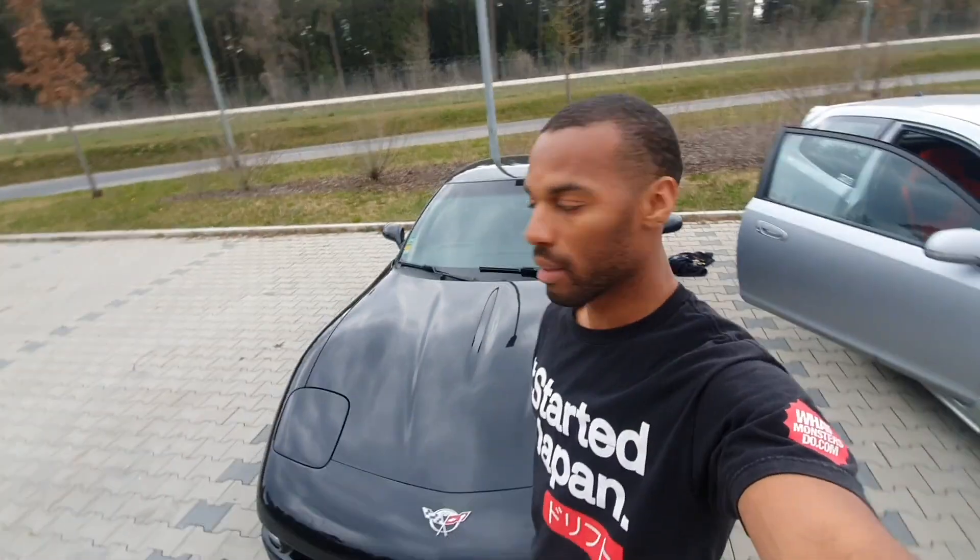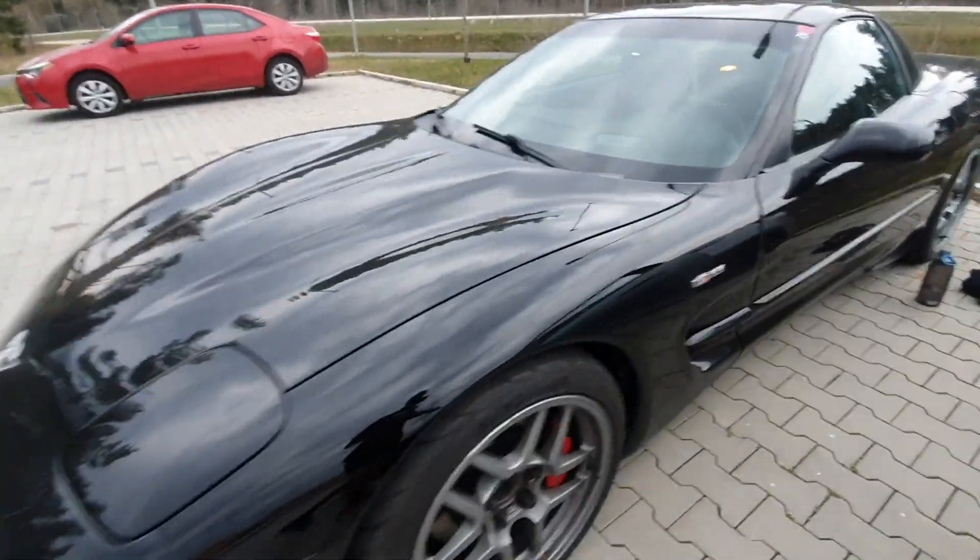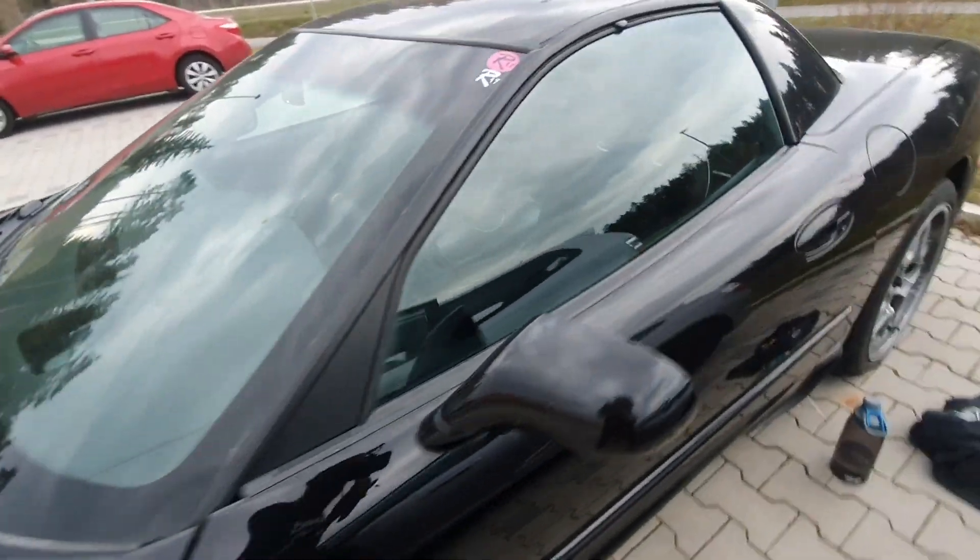The two-step worked pretty good. I started off at 3,000, then went down to 2,700, and then went to 2,500 - 2,500 seemed like a good place to actually launch the car. I don't really launch my car that much, but if I'm gonna have it I still want it to be functional. Good day, I'm glad I got that sorted out. If you have any questions, please comment below, like and subscribe - it really helps. Take it easy, I'm out.